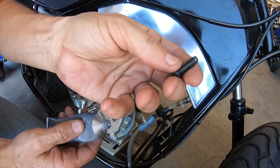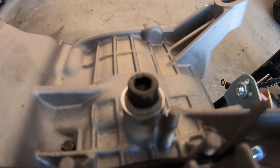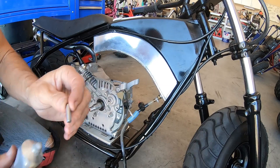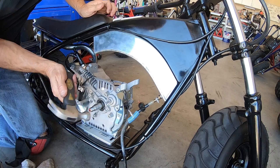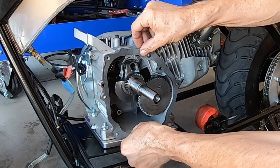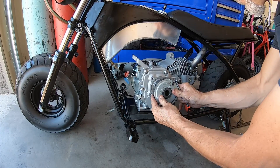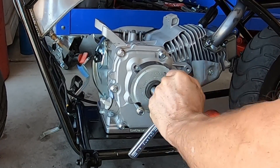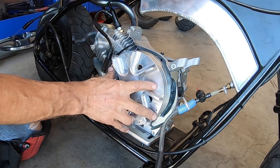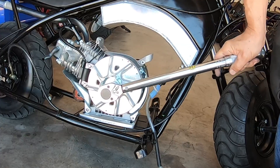There's a quarter-inch by 20 bolt on the top up here. Sometimes when I don't have a bolt to fit, to self-tap into this, I'll just use the press pin that I took out — I'll still add some RTV to it just to make sure. I'm going to lap this flywheel in with some valve lapping compound.